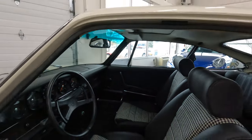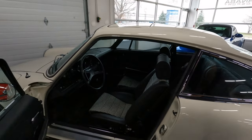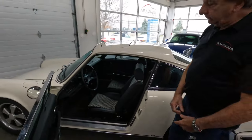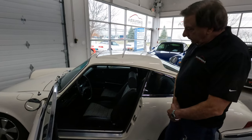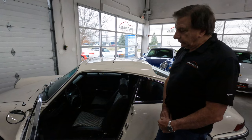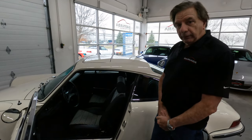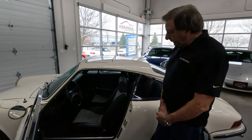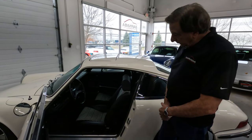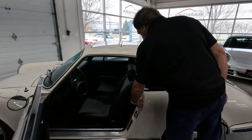And a new headliner. The gauges were all restored — new glass, new bezels, all reworked. Some of them weren't working properly so we've reconditioned those. It did have factory air conditioning; we've converted it to R134a with all the barrier hoses so we don't have any leaks from the AC. It does have the original Blaupunkt radio in it, and all that works perfectly.